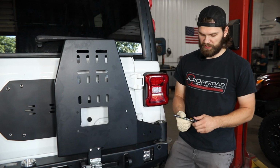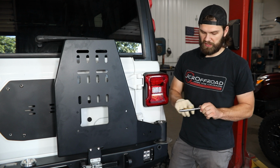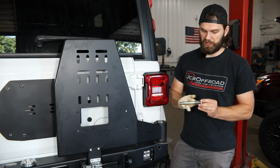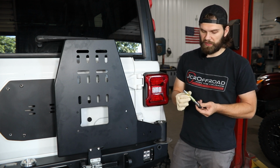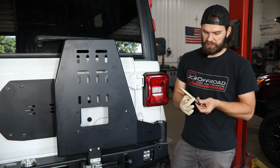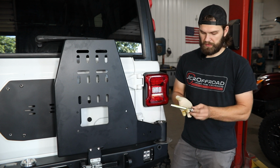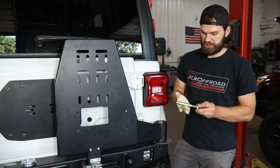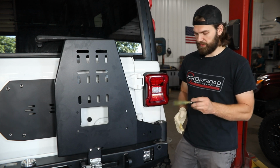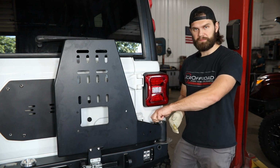Next, you can move back out here to the spindle area and install your locking pin. Now this is another item that you're going to want to be sure to lubricate, and this is something you're going to need to lubricate and maintain over time as well. So you may have to remove this somewhat frequently, just making sure that it always stays lubricated, clean, free from debris or corrosion. You don't want to go too crazy here so it doesn't push a bunch of grease out the bottom, make a big mess or something like that. But obviously you want an adequate film on there before dropping this down in and tightening it up.